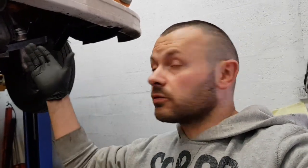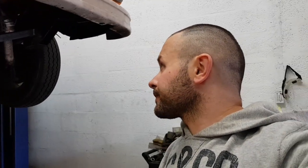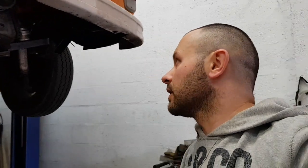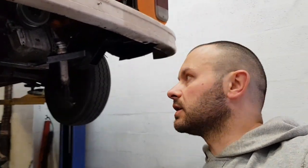He wants an equal-flow inlet plenum, which is very good because the standard ones I think are rubbish for flow. The charge cooler itself isn't expensive, but you need the radiator, the lines, and then a pump - you could go for a 50 quid pump or a 150 quid good reliable one. You add up all these small things and you get a pretty big figure, although for the power you're getting I don't think it's that big. But it's a personal decision.